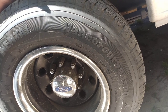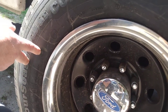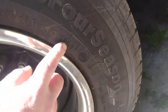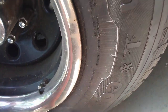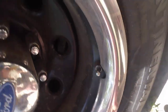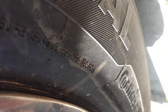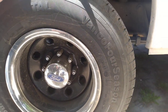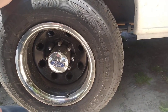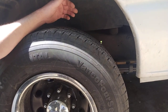The Van Contact has a theoretical speed load of 106. The current tire is a 128N at 75 PSI, or 123R for higher speeds. Max load single is 3,950 pounds — so about 4,000 pounds still. The Van Contacts are an upgrade to these with the same highway tread pattern, all-season. They're for RVs and buses, 30 inches tall, which is perfect for the Econoline cargo vans with the big tires — not the Econolines that require a 28-inch tall tire.